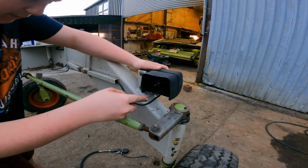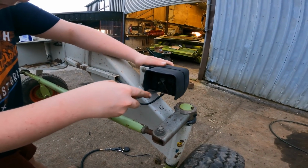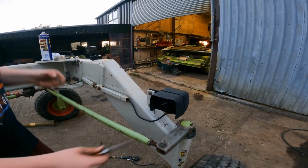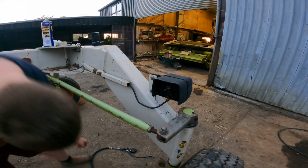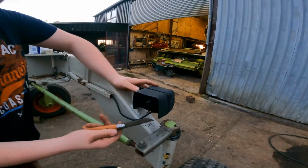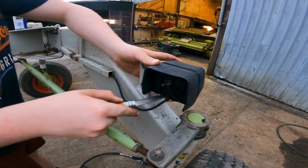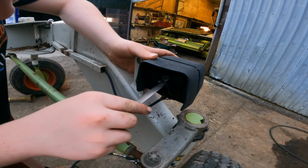So, bro is just cleaning the front lights to get them working. So, what do you have to do, bro? Once you take out the little bulb here, you spray it with the air hose and clean it. And then you get a sharp object to clean these. That one's quite dirty, the connectors. And you spray a bit of WD-40 and then clean it again.